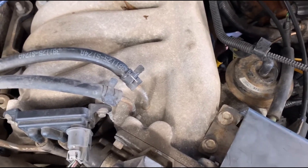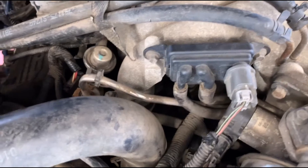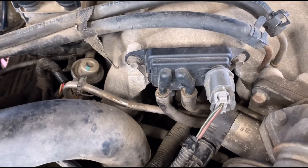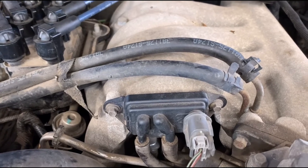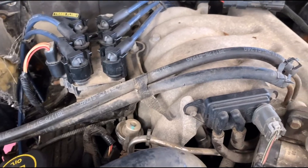The other thing I see a lot with these Fords is that the DPFE sensor will go bad — it is a transducer-based sensor and moisture, heat cycles, and other factors tend to be quite hard on them. It's common to have an insufficient flow code not necessarily because flow isn't happening, but because that sensor can no longer detect it. The other component to keep in mind is the network of vacuum hoses that make the valve go, and ultimately the EVR solenoid — those are other things to check and make sure they're in good condition.